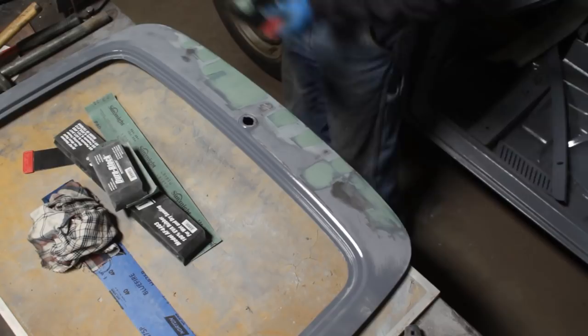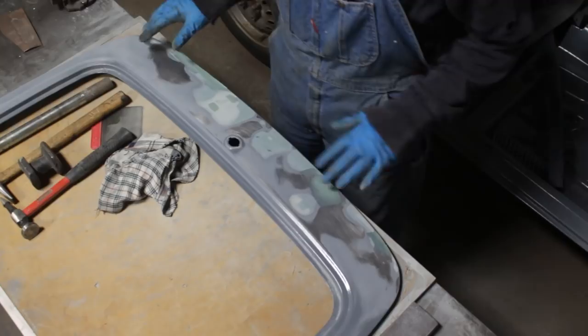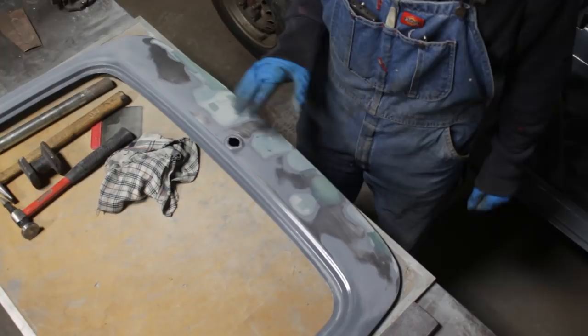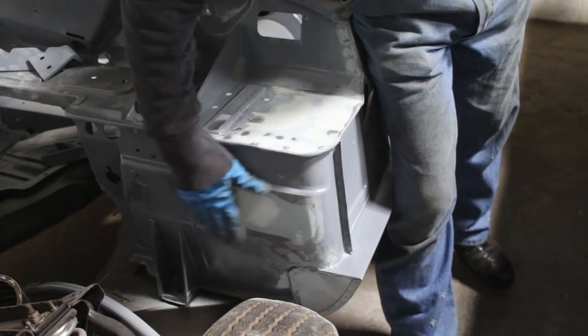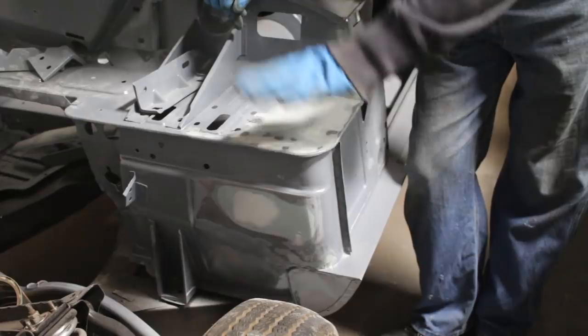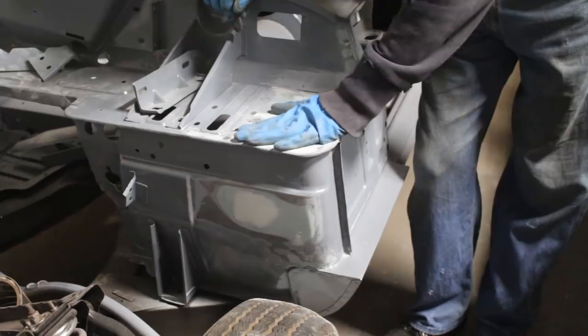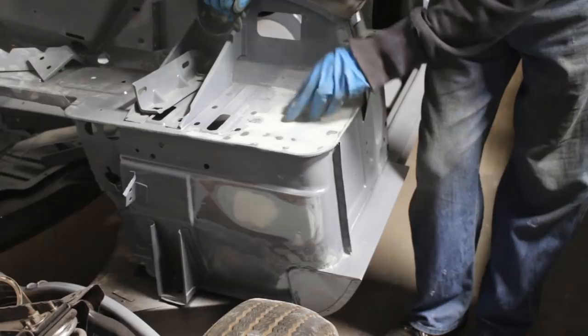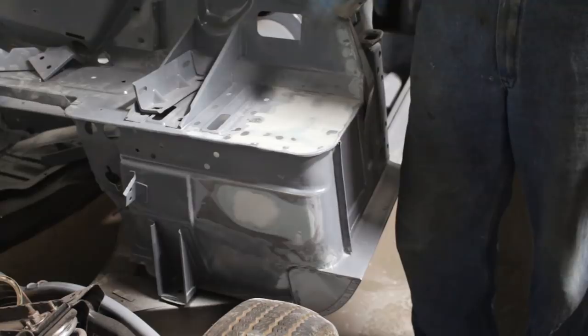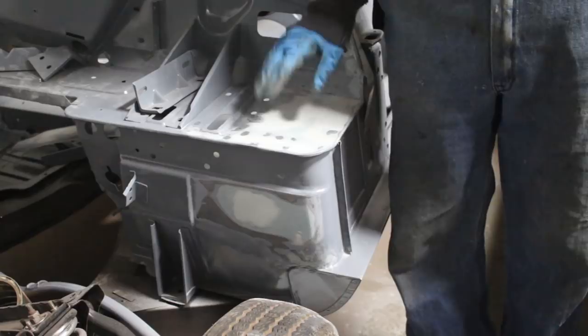I think it is pretty good now. After I sanded it with 80, I found another low spot here still, so I filled it up again and I think that's going to be the last for this one. The deck is also ready and this is also ready. Here I'm really happy with how it turned out. It looks spotty but it is wavy — it is not perfectly straight but I don't aim at perfectly straight. I aim at smooth and it is smooth. There are no lines. Actually, now that I said it, there is a line here, so maybe one more time I have to fill it up. But it is nice and smooth, that's what I'm looking for. So that's going to be the last for today.